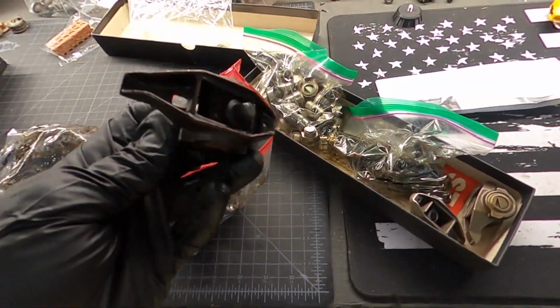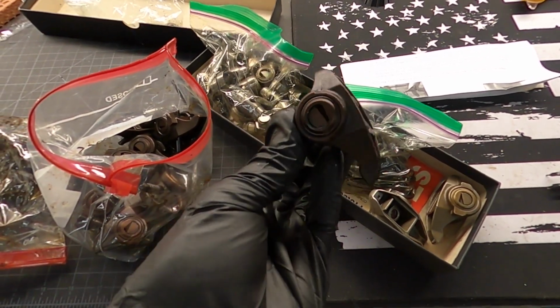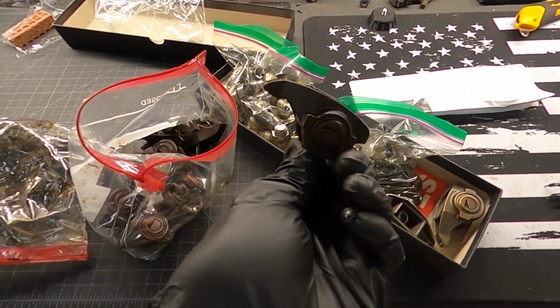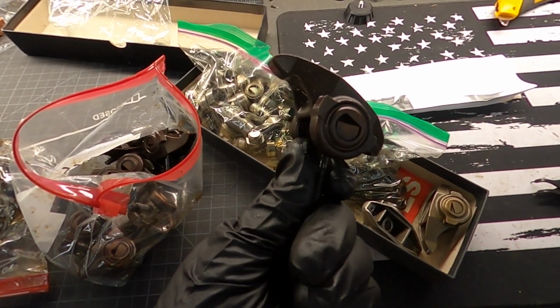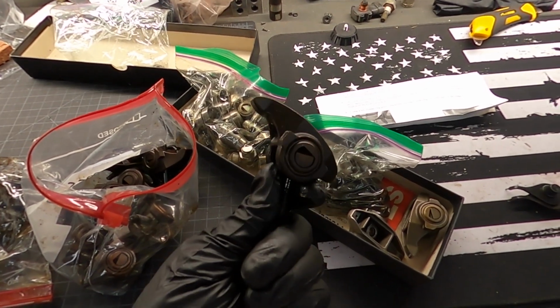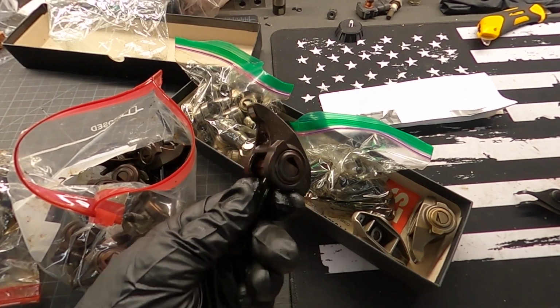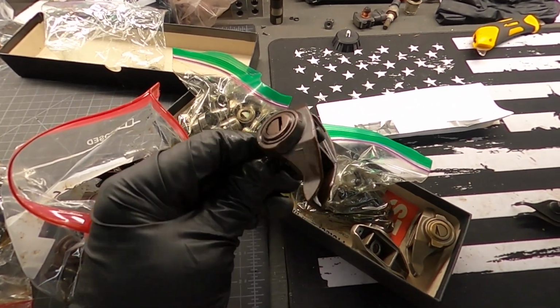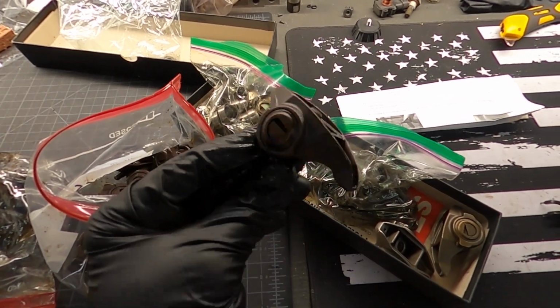All right. So next up, we're going to do a trunnion install. So this is a stock rocker off the car or the engine, and you can see that shaft only moves that much. And when you start to get into high lift situations with adding a cam, those can break, and then these little needle bearings go flying all through your engine. And I know this because it happened on my Firehawk.